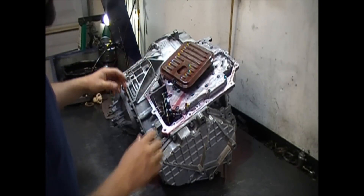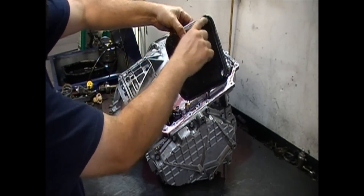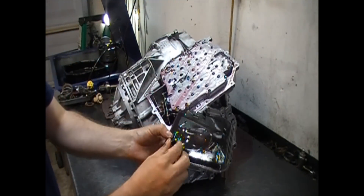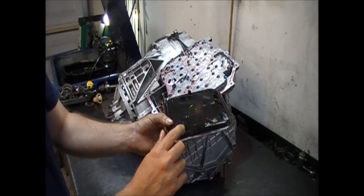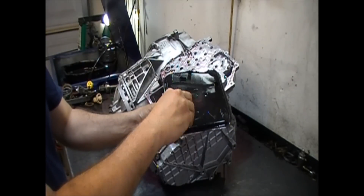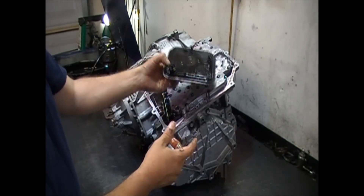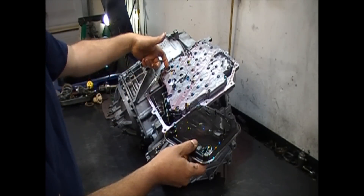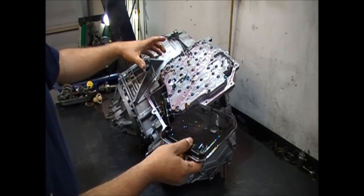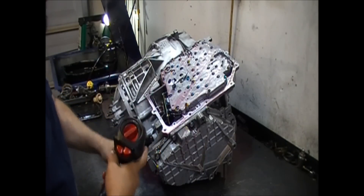This is our filter — it has two little clips that you can unclip. Make sure your O-ring is on the filter. It's actually not on the filter itself but it is present here. Sometimes you would do an oil change or transmission fluid and filter change and this O-ring doesn't come in the filter. Some aftermarket filters have started putting this O-ring on, but most filters you get won't have it. If you don't pay attention and change the filter without the O-ring, you're going to cause an issue — it will actually throw a code for loss of prime.